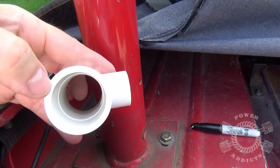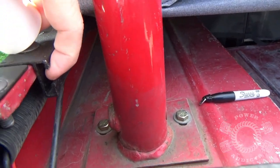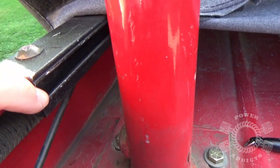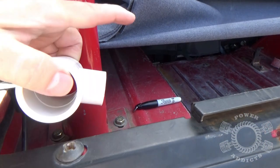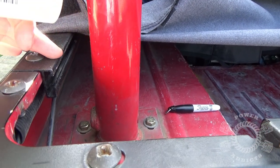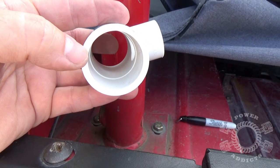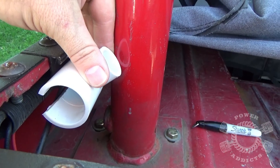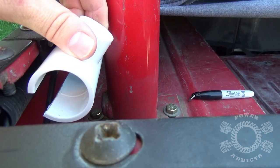So what we're going to do is look at modifying this, cutting right along there, because that's going to set me up where I can fit my groove. Cut here to about right there — that's going to allow the bottom of it to fit down inside the bottom groove. And as the pipe rises up for that arc, you're going to catch the arc right along in here somewhere, touching the top right along in here. Then you're not going to create a whole bunch of stress on the edges of the material where it's going to be stretched the hardest. I took my little Dremel tool, sliced that right there, and it fits right down inside that groove right there.